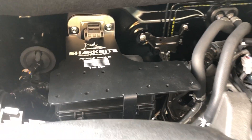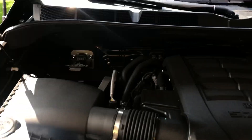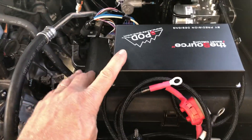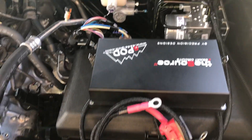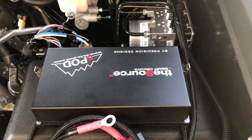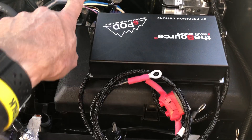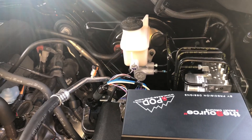As far as wiring, my intention to get power to the air compressor is to bring my wires across the back of the engine compartment here. In my truck I have an S-Pod — it's kind of upside down here — but it's an S-Pod power distribution unit. You open that cover and that's what you use to mount all your accessories such as air compressors, lights, and things like that. Just put the negative and positive down inside of this and that will be good to go. This has a switch that goes inside the cabin of the Tundra to a little switch box where I can turn on and off the air compressor and other accessories.